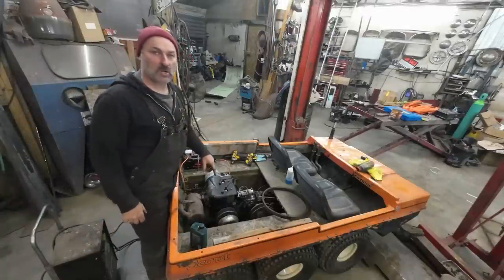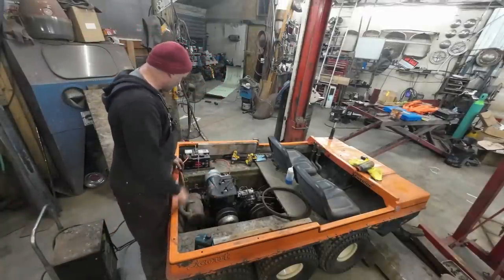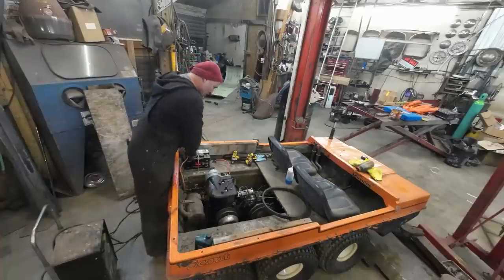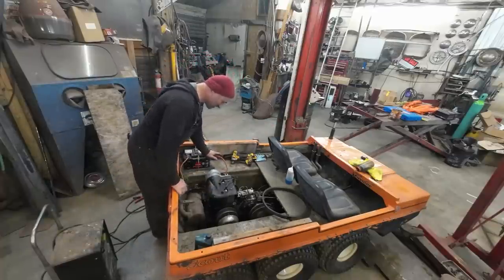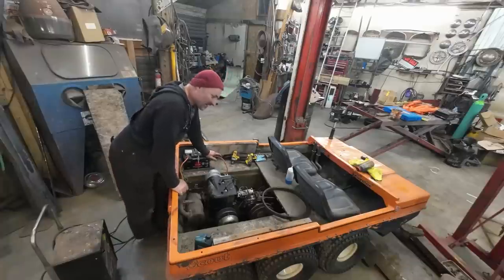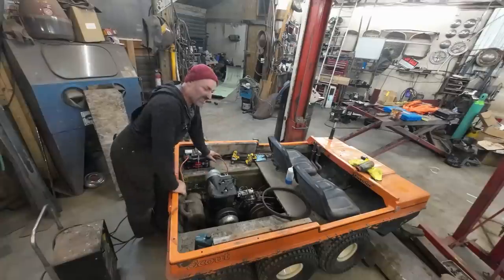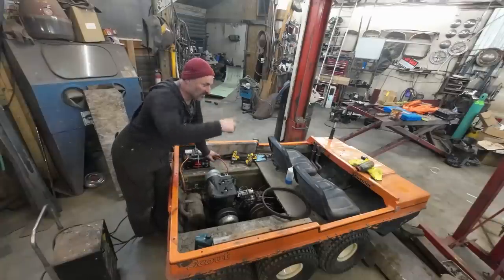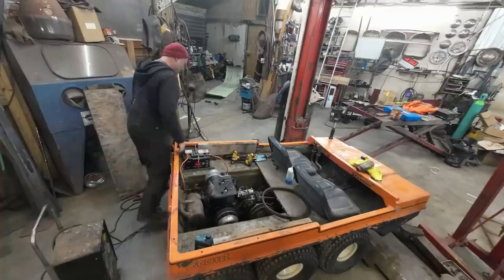So I've had to take it out multiple times to do the points, but we got them set. I think we're pretty much all ready to rock. We got our temporary fuel tank in, again. I'm going to have to figure out some kind of a fuel tank. That one, you can't take apart to clean, and it's got a lot of water and oil, and it actually dips from the top, so I don't know if I can clean that and fix it right or not, but anyways,